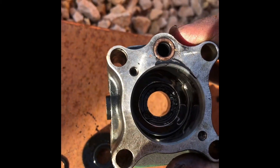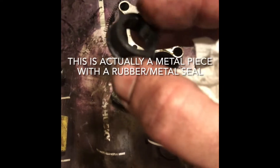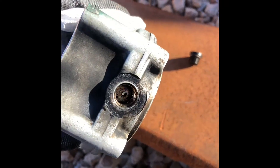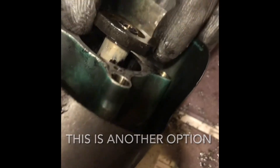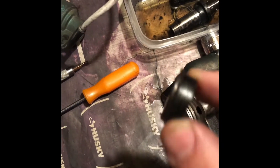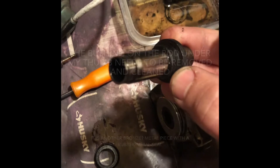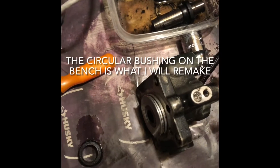This is filthy in there. Here's another spring clip, so let's take that off. The back side — used a socket and knocked that. I think I found the problem. You take that off and there's a little orifice. I can just push this all the way out the other side — the small port goes to the back side of this. This is the part that has all that corrosion all over it, and is not allowing this to slide back and forth through it. And when it seats against right here, that's where all that gooey hot oil has been building up and sticking those together. That is where the main issue is.